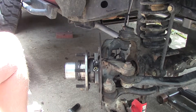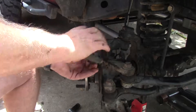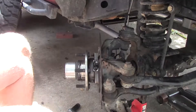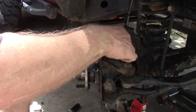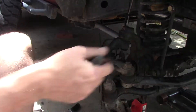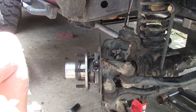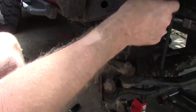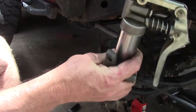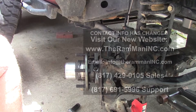We have greased our Timken bearings. I wanted to show y'all in this video — I went ahead and pulled the wheel and tire. But if you make this little modification to your dust shield and you're a little careful, use things like a ball hex to get in there. You can grease these things with it sitting in the driveway, sitting on the pavement, just getting up underneath here with a little fluorescent light. You can grease these things with a grease gun and a little hose without taking a damn thing off. Believe that — never been nothing like it in the whole world.